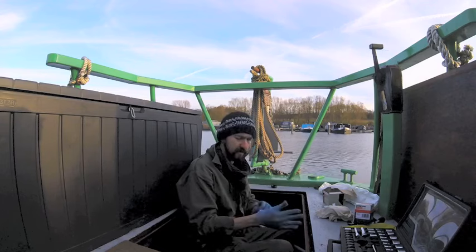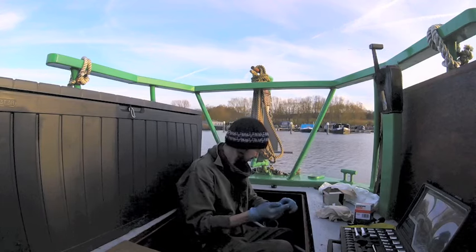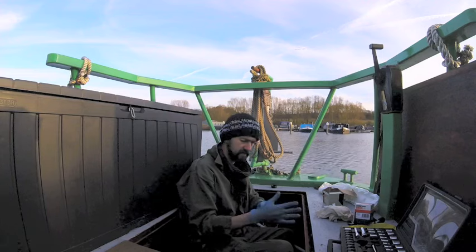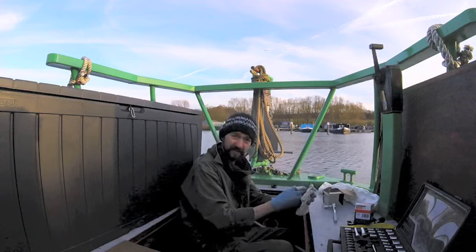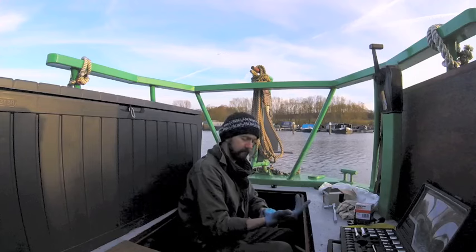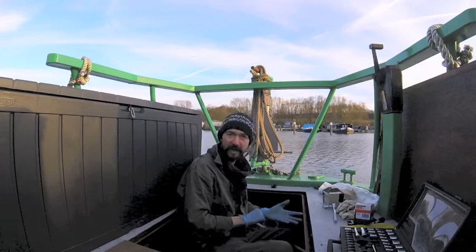I now have to check that there aren't any air pockets in the system, and start up the engine again. I will also check to see if the oil is at the correct level for the engine, and for that I have to just check my dipstick, which is right underneath the oil filter I have just changed. So there we go. Oil change, fuel filter check done.